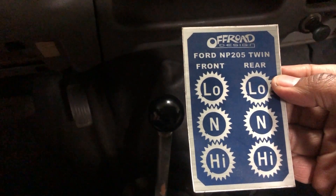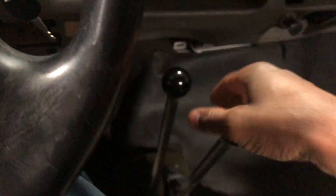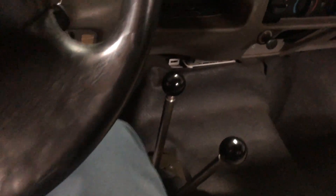Once you put this in gear — right now it's in high — you don't need to do anything. If you need to go in reverse, it's all controlled from the screen. We've got power on from the traction pack. Once I turn this switch forward, this is going to come on. You're going to hear two clicks — those are your high-voltage contact relays. Once those are connected and it goes through the pre-charge resistor, the power is up and this thing is ready to be operational.